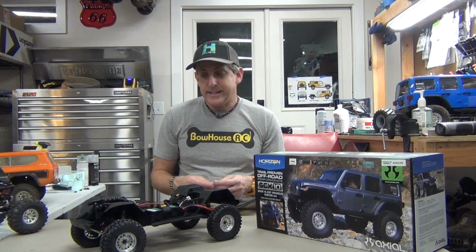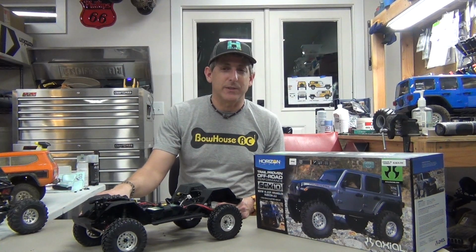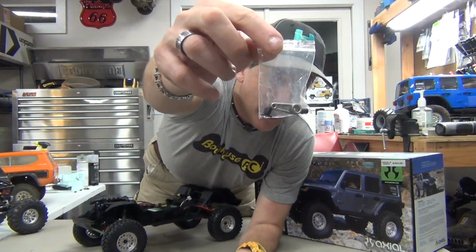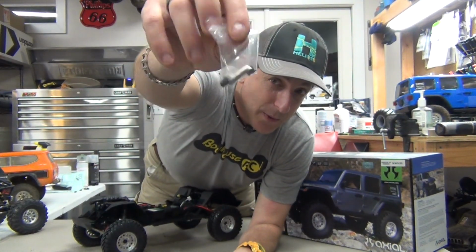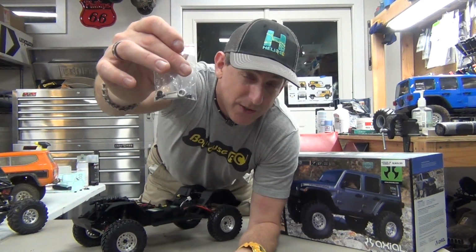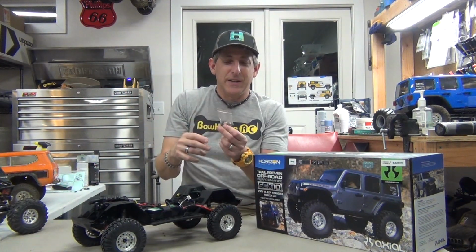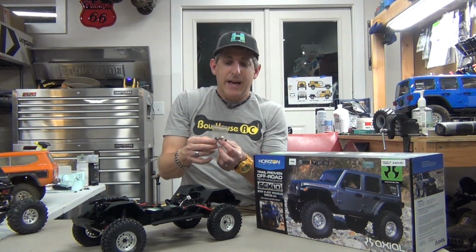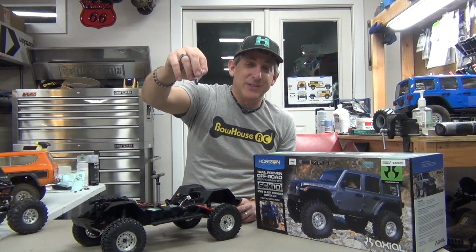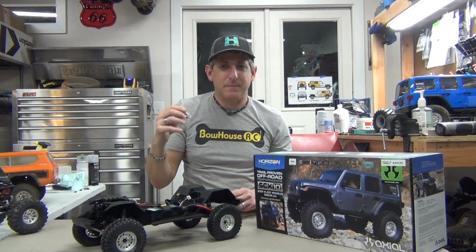Interesting to note that at getting to the point of having an actual roller here, I did not use the stock wheels and tires on mine, and I hadn't put the body together. The sum total of spare parts left over are a 23 tooth servo arm, because I used the 25 tooth, the 2 spacers to lock out the shift and dig servos. Didn't use the lockouts because I'm actually using the 2-speed and the dig, and then one little spacer that's intended to go in that grommet in case you're only going to use 2 of the 3 servo wire pass-throughs going into the receiver box.